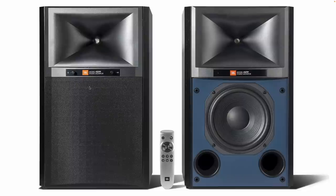The speaker on the front features an eight inch midwoofer, a set of ports, and then a one inch compression driver in a JBL high definition imaging horn design. The speaker does come with a remote and then it comes with an ethernet cable to link the speakers together. However, there is no HDMI input. The built-in DAC supports 24/192 sampling, and it also has AirPlay too, so if you wanna do streaming directly to the speakers, you can do that from your phone.